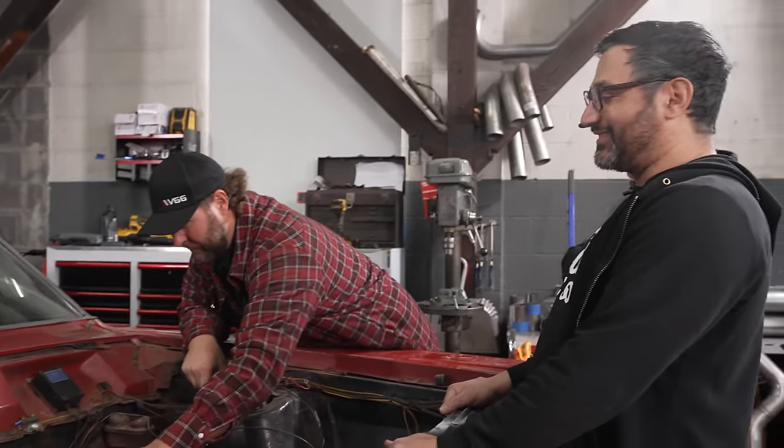Doing the brakes over here and the hardware kits. You can get these, they're fairly universal, but none of them come with the brake links in them, or shuttle, I call them, or this retainer up here, shoe retainer, which holds the shoes from coming out. So I just made one out of a strap here. That'll go on there and hold those shoes in. We couldn't find these anywhere in town.